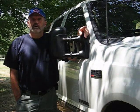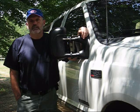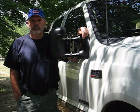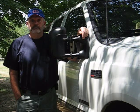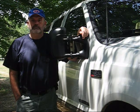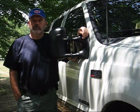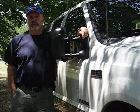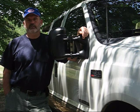I should mention that when I was bench testing I couldn't get it up to very many amps, but as soon as I started the truck and took off, the amps immediately spiked up to 64 amps — with the temperature at around 57 degrees C at that point. By the time I finished driving 20 miles, the amperage had dropped to 57 amps and the temperature had dropped to 52 degrees C. So for about the second half of the test the temperature had dropped quite a bit, and for at least a little more than half the test the amperage draw was in the 56 to 58 range.